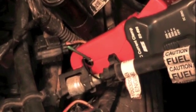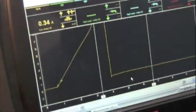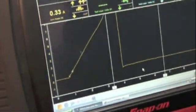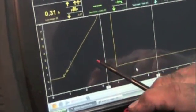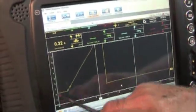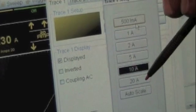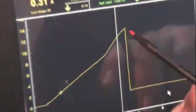Now we're going to start it up. If you can hear this, you can hear the misfire — we do have a bad coil. We're on the middle one on this side. Is this the bad coil? Well, you can't see the top of it, so you need to adjust that. This controls your time and your voltage. We're set too high, so we need to go to our traces — we're set on the yellow trace for 10 amps. I want to change that to 20 amps. I hit OK and OK.